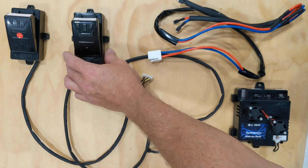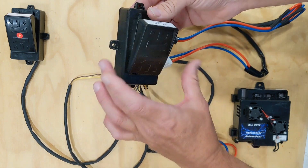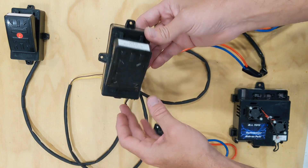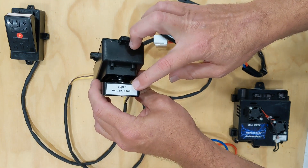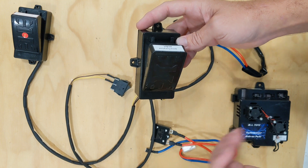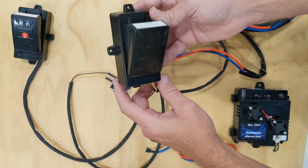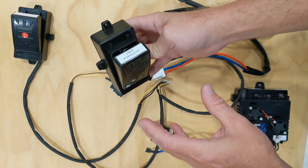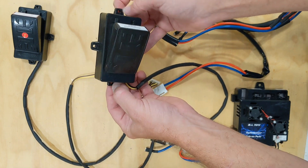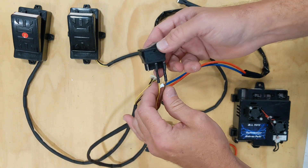Once you remove all the wiring, you want to first locate where you want the pedals to be mounted. The kit's going to come with some mounting screws — you just need two to hold the pedals down. You can put some double sided tape or glue if you want, but the screws seem to be working well on all test vehicles. The pedals will be marked for accelerator and brake so you know which is which — they're not interchangeable. We recommend setting it up just like a real car with the gas on the right and the brake on the left. Have your child sit in the car, feel out where the pedals fit them best, mark that spot, drill two 1/8 inch holes, put the mounting screws in, and you're done with the pedals.